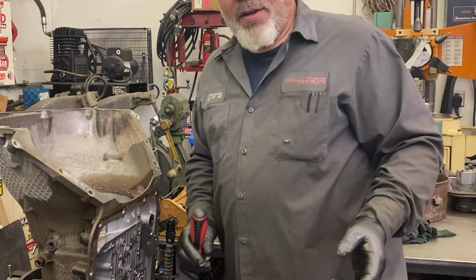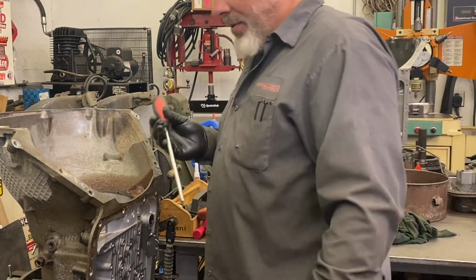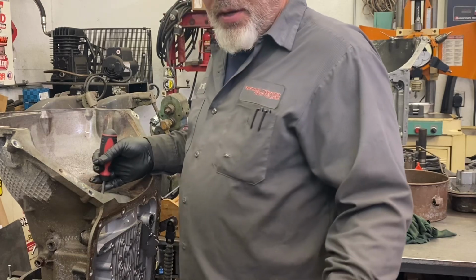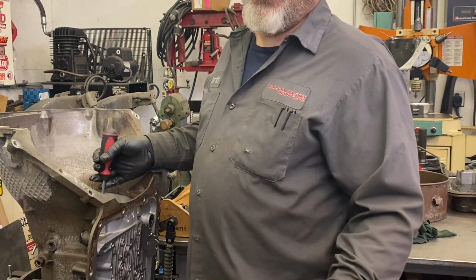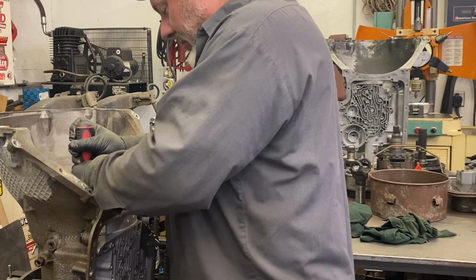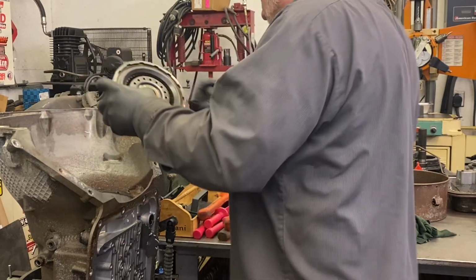The direct clutch housing is next, and as you know, if you watch my channel, that's a part we retrofit into the Turbo 400. So my method is this big angled pick to grab it and get it out. Again, they do make a special tool I don't have. You can take the clutches out, which would make it easier, but I just like to grab it and pull it. As I say that, it gets caught. Okay.